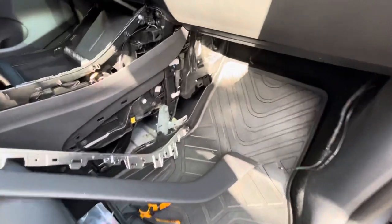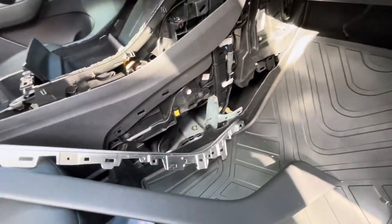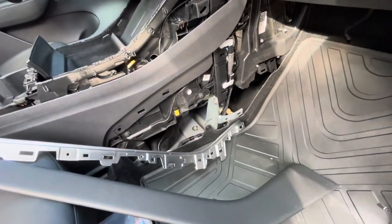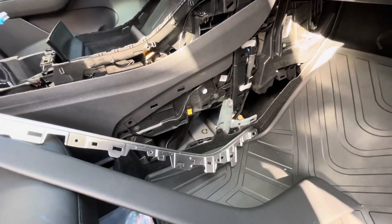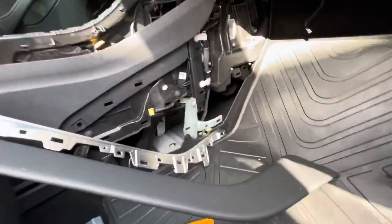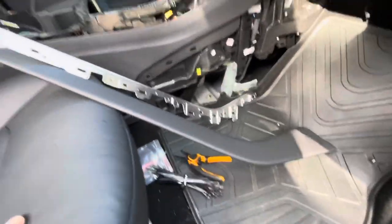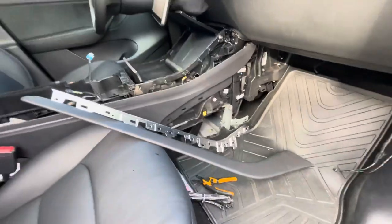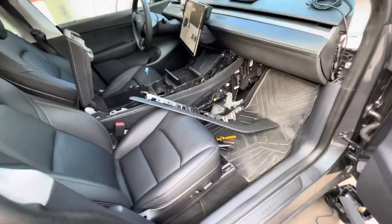When routing these wires, keep them away from things that snap in and from screws so you don't pierce them when you put things back together. When you pull on the big panel, be very careful because clips will sometimes snap off — just be careful when prying. I'm posting this video so people know where to pry with their trim tool and don't crack their plastic or leave marks in it. I hope this video helps someone, because none of the videos I found were helpful.